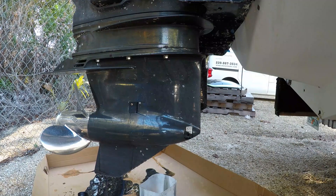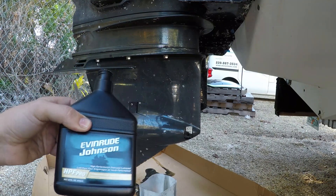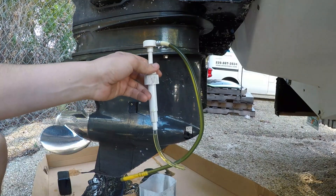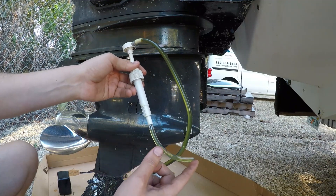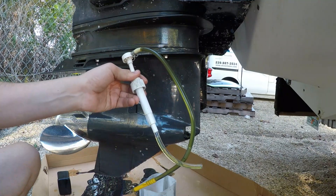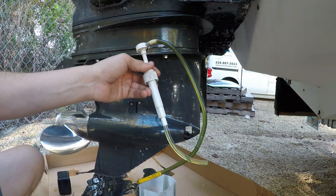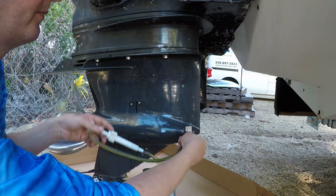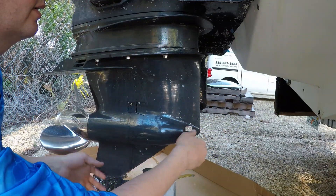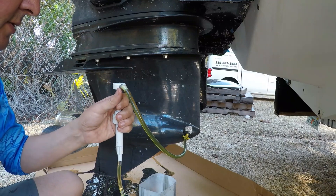There will be a little bit left over from the old stuff — you're not going to get it all out. You cannot do the job without this pump bottle; these are only like five bucks. I added a little piece of flexible tubing — the one they give you is a hard tube, but this one's flexible so it lays on the bottom a little bit better. Just a piece of clear aquarium tubing. Thread it in, screw it into the bottle, and pump it like a bottle of lotion. From what I found, this is the same thread as my old Mercury, so at least there's one thing all the manufacturers agree on — to make the drain plug threads all the same.